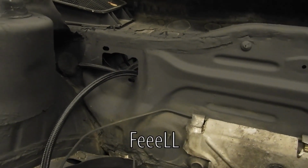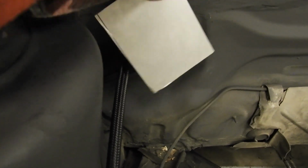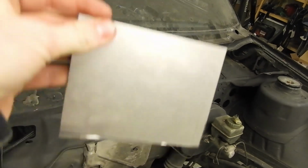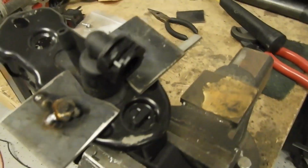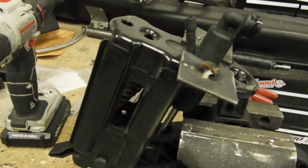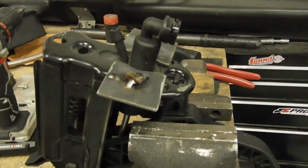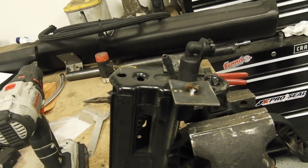In-depth look at the hole we're gonna fill. Shifter linkage, but it doesn't have a seat clip on it, so it just pulls out. Got the nuts tack welded on there. So we're gonna cut out the firewall as you saw in Cole's recording. I might have to flapper that a little bit to get it to fit. We'll run a bead across that on the inside, run a bolt through here, probably tack weld it on the other side of the firewall. That'll be mint.